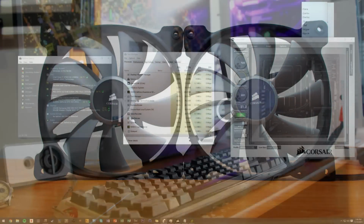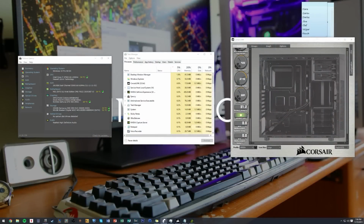While the SP140L fans may not look as flashy as the LED counterparts, they definitely perform better. Their increased CFM at lower fan speeds, because of their 2 extra fan blades on the actual fan itself, definitely show their stuff here. The sound level is decreased greatly, and idle temps are on average 4 to 5 degrees cooler. The fans are running at a fixed rate of 900 RPM still, and the pump is still in high performance mode.